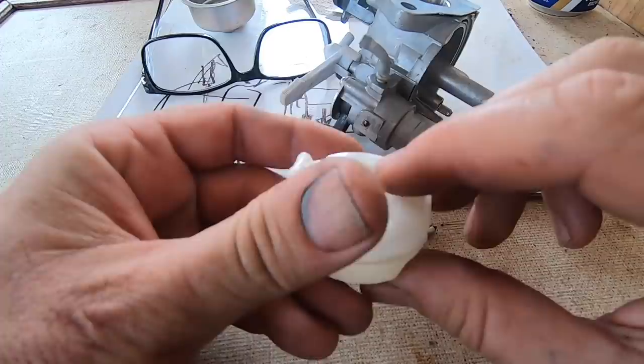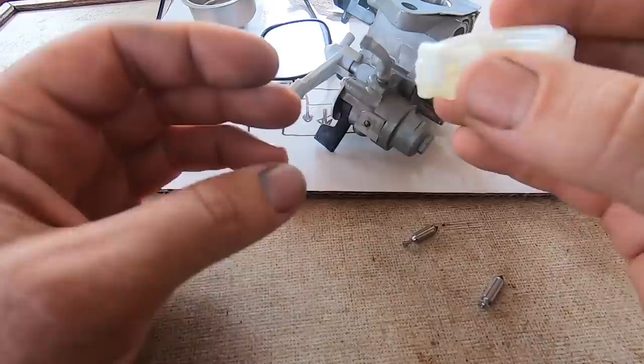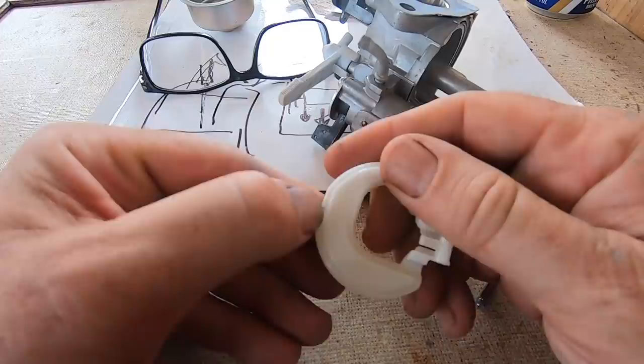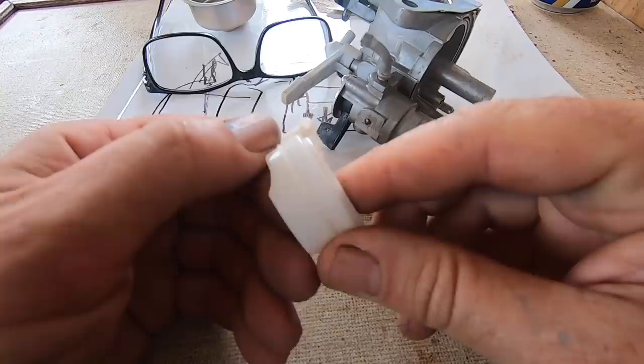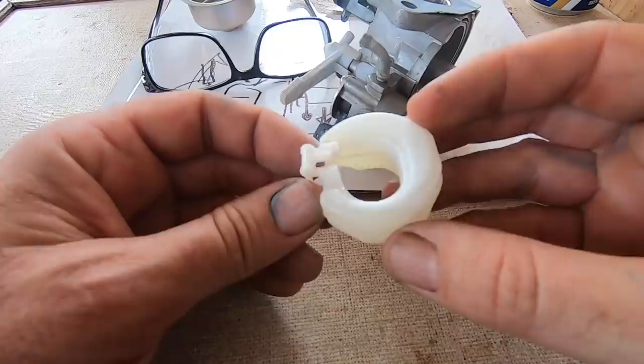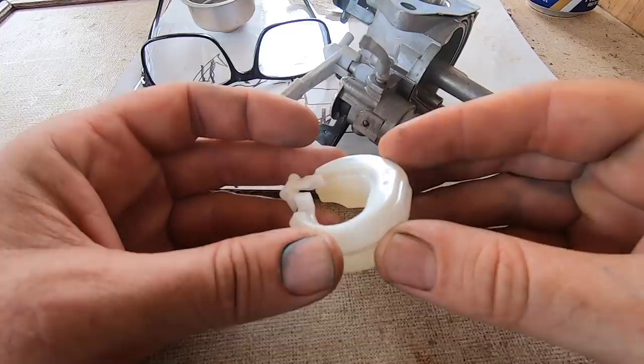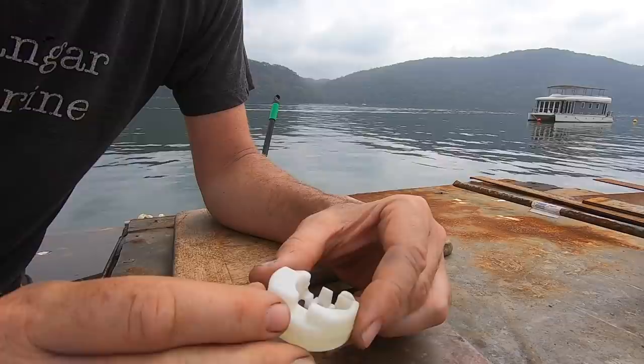In order to get power back in the meantime, I'm going to take a photo of this one to find the right one, but also just try to drain it. I've not had a drop of this fuel come back out — I've been shaking it, and I just can't see where it got in. I think it was a manufacturing fault, probably always had a slow leak. So I'm tempted to just drill it, empty it, plug it with some fuel-resistant sealant, and use it until the correct one arrives.